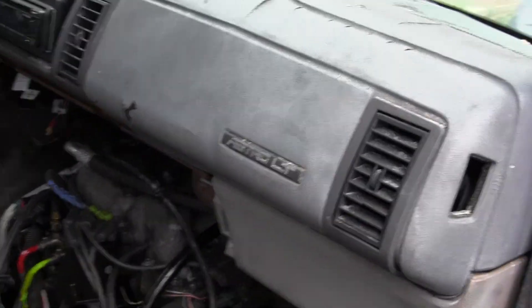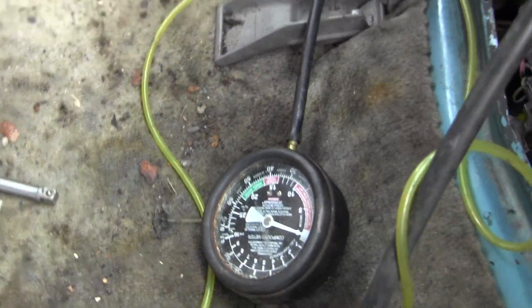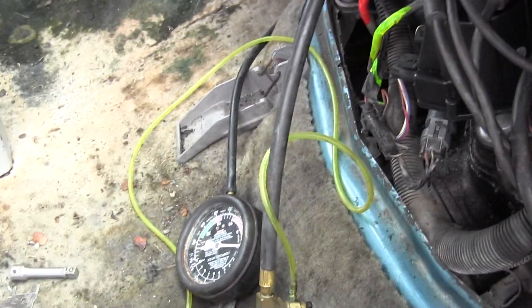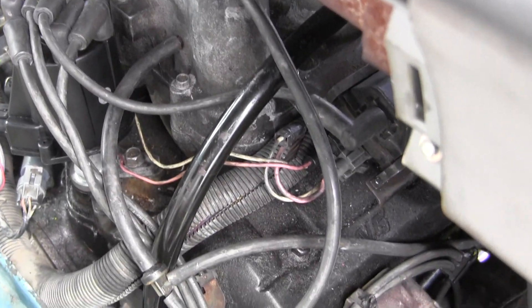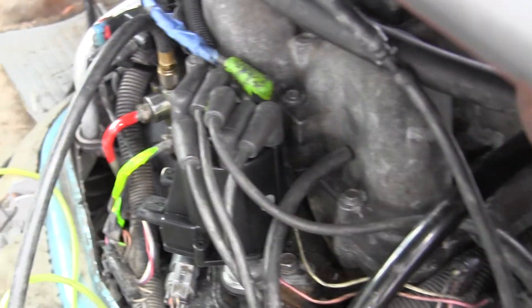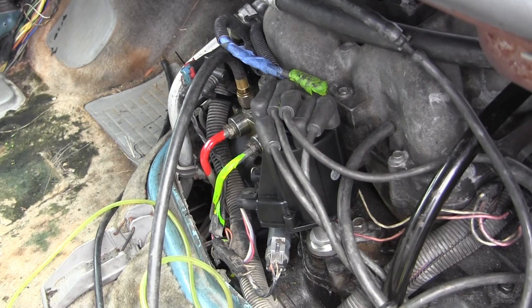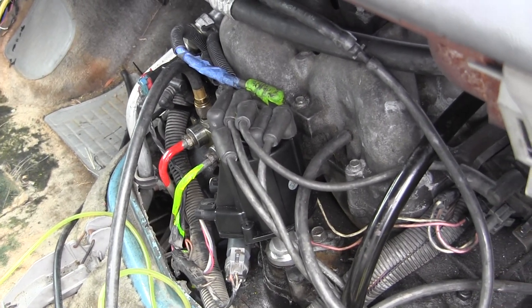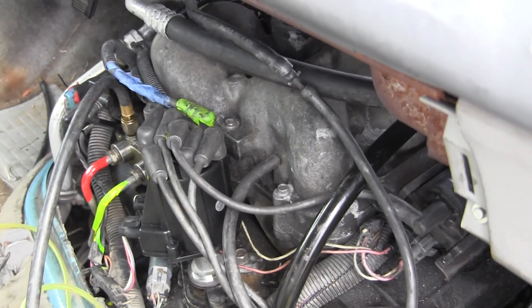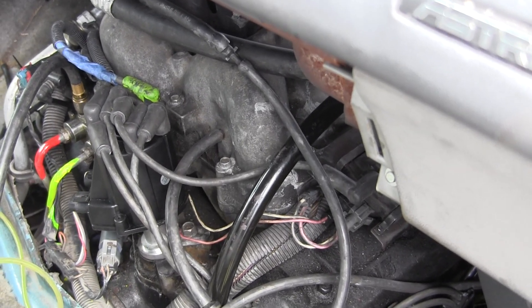I can't seem to win. What I'm going to do next is — I pulled out the spark plugs, and at least half of them are black as coal, and those were new not that long ago. So it tells me this thing is running richer than hell. I'm going to pull all the spark plugs and set the timing, because that's the other point of confusion. There are two timing marks on the harmonic balancer and I don't know which is which. So I'm going to set the timing, paint up things, mark things, and do it right. Then I'm going to pull the upper plenum off and probably pull out the spider.